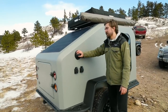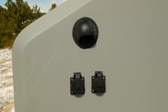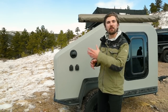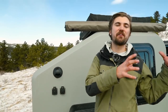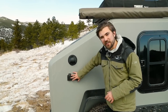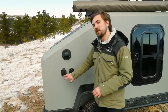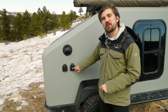Coming back to the ventilation, this is your exhaust from the entire system — exhausting your electrical in the bottom. You have a lot of battery and a lot of inverter power, so you want a lot of airflow. This also moves 240 cubic feet per minute out of your interior space. Crack a window and that means it's refreshing your interior air every 30 seconds. On the side of the NS-1, in our demo unit, we have 120 volt in and 120 volt 30 amp out.